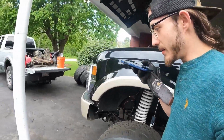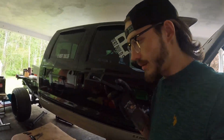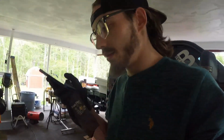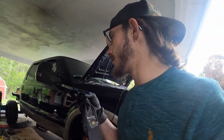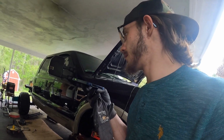Right, and definitely probably the best thing you could do if we tuned it is, once you get it running and driving, just take a data log and send it into our tuner and explain to him what all you changed on it. Yeah. And then he can go through and tune it up and give you a little different tune for it then. Make sure it locks up, because right now you might be basically flaring it out of gear and then it can't grab again.